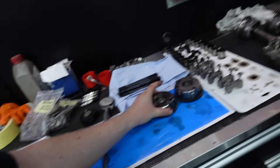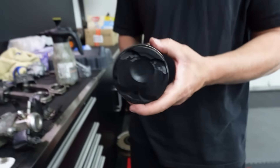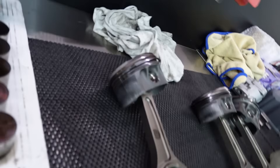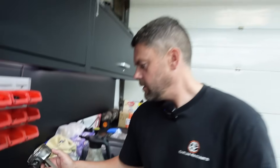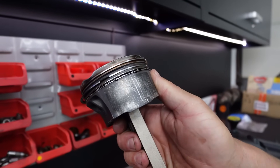The cam phasers are all right — they're not full of swarf or anything. There wasn't much swarf in the sump, only a little bit of the bronze, and it goes really fine. So that most likely hasn't damaged much, although it has damaged the oil pump, so we're going to be looking at another oil pump. I think we'll probably be getting back to the customer suggesting we either get another rod or maybe make a new small end bush. Looking at those pistons now, I'm not totally keen on them anymore — the skirts are not great, and there's probably what looks like impregnated debris from the small end bushes, a lot of bronze impregnated.